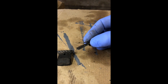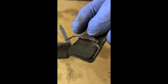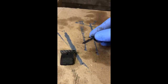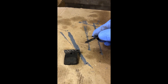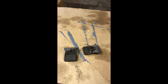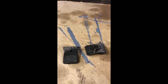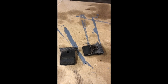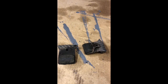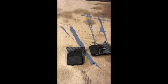As you can see, these are my pads and there's still a reasonable amount of pad there, but it's getting fairly close to where the spring sits, which means very shortly we're going to start hitting metal. That's a bad thing for the rotor, because as soon as the metal starts rubbing the rotor you can knacker it. What you do then is you turn your disc rotor into a file effectively, which buggers up your next set of pads. So really important that you don't let that happen.